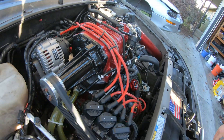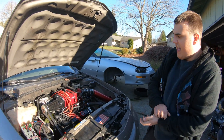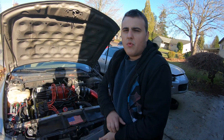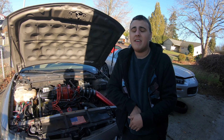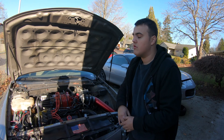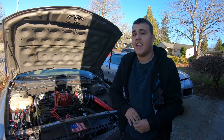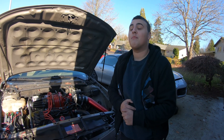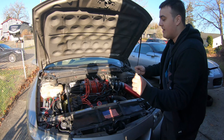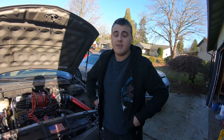If we did, I mean it's not the total end of the world, but it would suck. At very least going under the knife again, we're going to need to get the harmonic balancer off. We've done it before — last time me and Davis did it while the car was running. We had to get it off with the engine's own torque. We put a breaker bar in and turned over the motor with it on, because none of our impacts could do it. We had to wedge it between the asphalt and a car battery — very sketchy. I don't recommend that unless you need to.